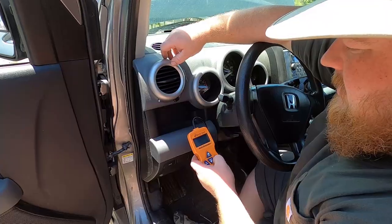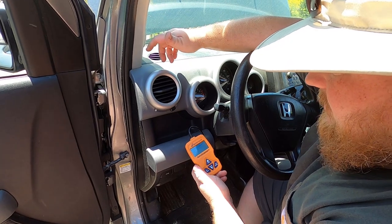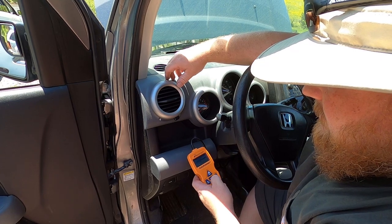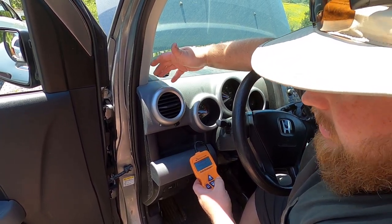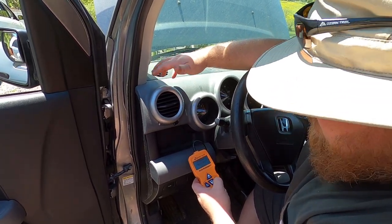It is running, it's not clickety, and it's not blowing up — successful so far. The code reader shows P0302, misfire detected — same code we've always had. I'm going to click to erase. That was the only one. The exhaust valves were way too tight on every cylinder, so cross our fingers that we fixed it.